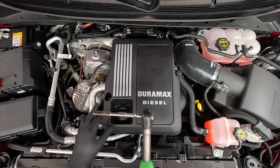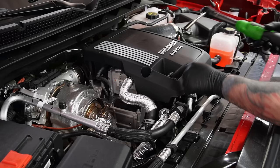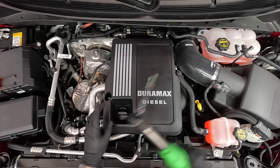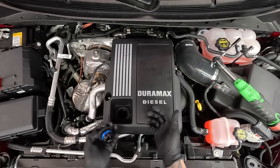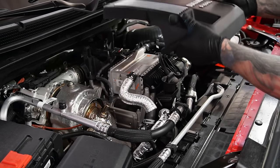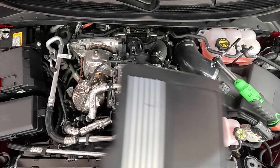I got my quarter-inch ratchet here. We have a 10-millimeter bolt down here. Oil fill cap right there — we're going to take this off after we get this off. Pull this off first, set that down. Oil cap can come up, and then we'll pull up on this cover. Get that out. Put the cap back on so we don't have any debris fall in. This is why we pulled up on it — that's just connected right there. We can set this aside.